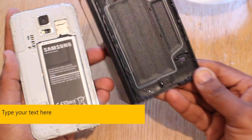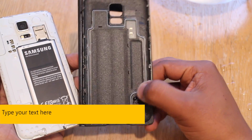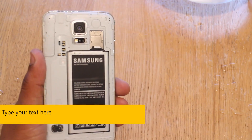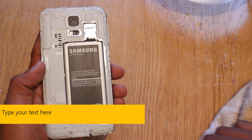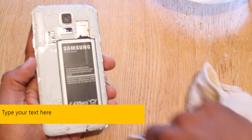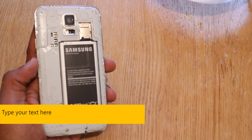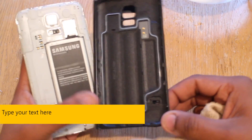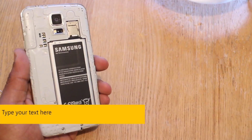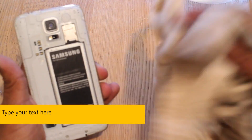Let's peel the back cover off. And you can see there's quite a bit of water inside the back cover, but crucially it's all outside this particular seal, which is the most important seal — because that's what remains waterproof. We'll move the back cover to one side. On the device itself I'm going to point out where I can physically see water: a little bit on the sides, nothing much up top, and some down the bottom. Crucially it's also covering the speaker here, which if we look at the cover, you can see it's not covered by the seal because that's where the speaker port is. So now we're going to give this a wipe down, and you can see there are little bits of water dragging across our battery, but this should hopefully be okay still.